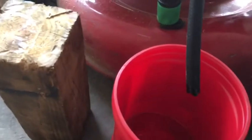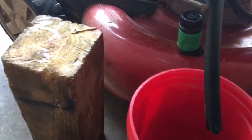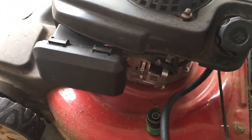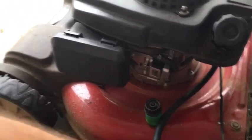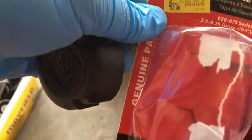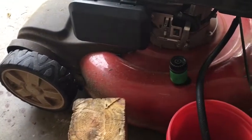This is one of those Crapsman engines from China — it's a Honda clone. I've got another cap that may or may not fit; it's a brand new Briggs cap I got on clearance for a dollar. It's for a Briggs Quantum — may or may not fit this engine. I switched caps to that Briggs cap and it's flowing real good. So that's the problem.